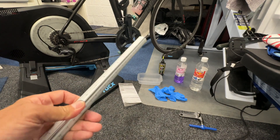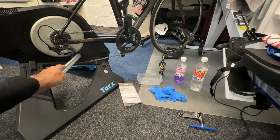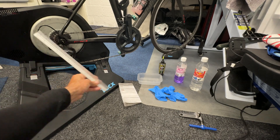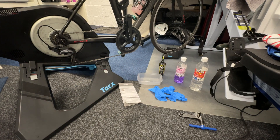The chain will be at an angle and also at its slackest. You want to check it's not too slack — the spring mechanism will increase tension to take up slack, but there's only so much it can do. If it's super slack, you may want to shorten the chain. But if you shorten it too much, when you're on the big front cog and big rear cog, the derailleur arm will be overextended.